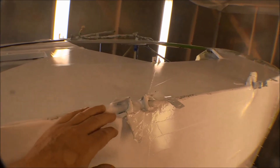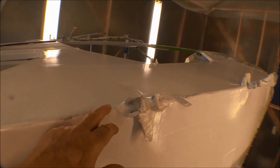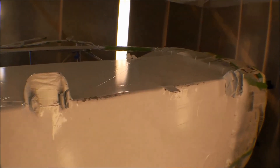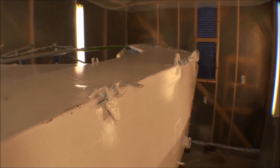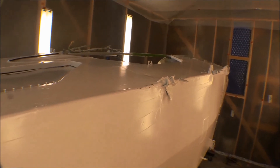The runs are on the belly underneath between the landing gear, and the belly tank bolts up against there anyway so I'm not going to fool with that - all I could do is screw it up worse. Some of the runs came over the bottom and showed on the lower longeron, so after letting it dry overnight I brought a razor blade over and trimmed those runs off, then took some 400 grit sandpaper and smoothed them out. I'll mix up some more polytone and spray over that to clean up that edge. Otherwise it looks really nice and it's white - I'm almost tempted to leave it like this.